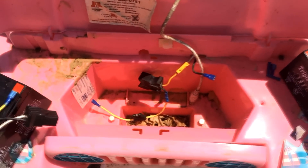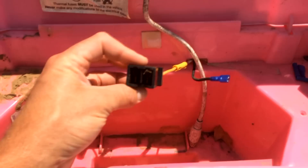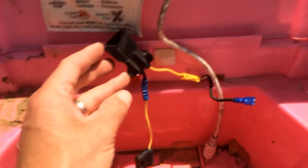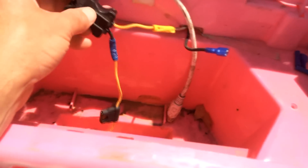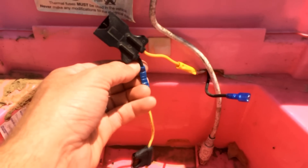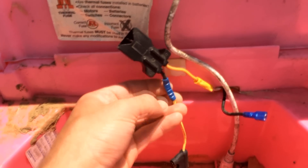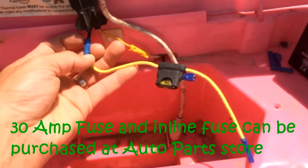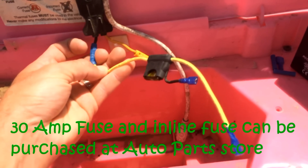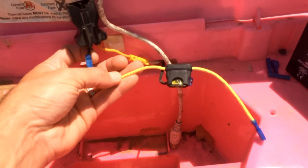This was actually a six-volt connector here, but I'm using it the same as the 12-volt Power Wheels battery adapter. To modify it to 18 volts, first you'll have to cut the black wire from the vehicle to the stock Power Wheels connector. You'll need an inline 30-amp fuse holder — this protects it from the batteries overheating or catching fire.